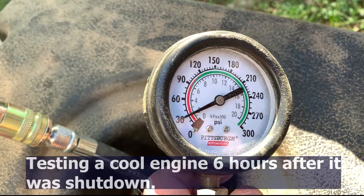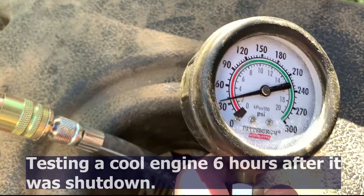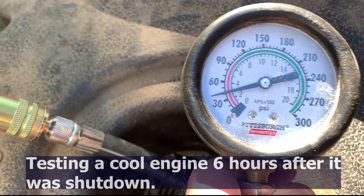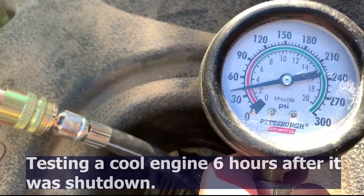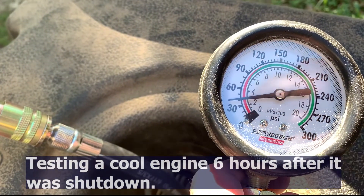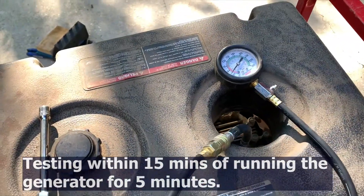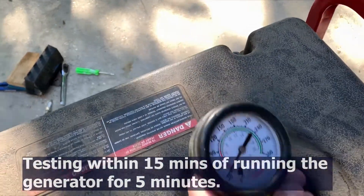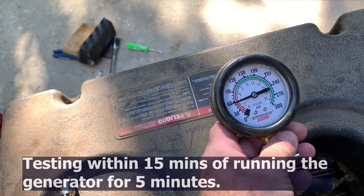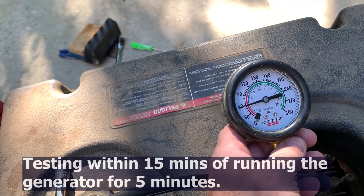The tests were done after I ran the engine for eight days because of the hurricane. I ran the engine that day to warm it up — about a half hour — then let it cool down for about six hours and did the pressure test. Instead of getting 30 pounds like we did on the first test, we ended up with about 40 pounds. After reading the service manual, the directions were to run the engine for five minutes to warm it up and then do the compression test. Using that technique we came up to 58 pounds.